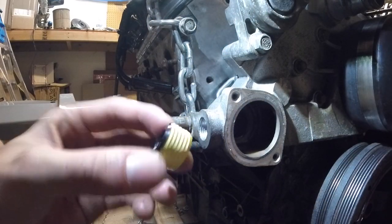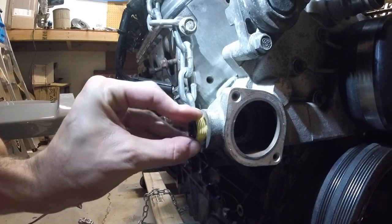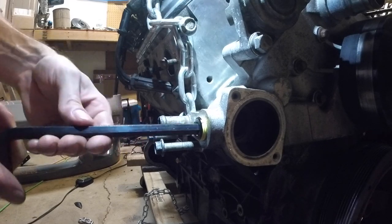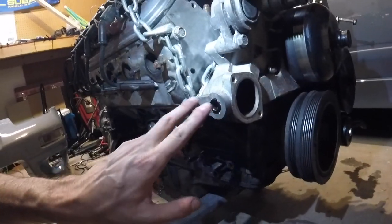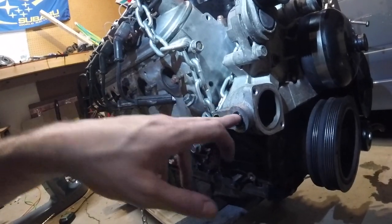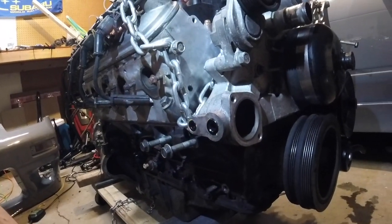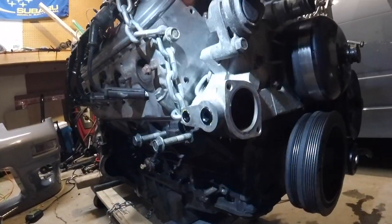Last step: wrap it up and plug it in some Teflon tape. That'll do it for this quick little video — plug up these two holes so I don't have to worry about having an ugly U-pipe or anything like that, and it's done the correct way. Go ahead and bolt the thermostat back on, clean all this up. Hope you enjoyed it, hope you learned something, and hopefully you guys can try it yourself too.